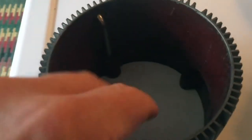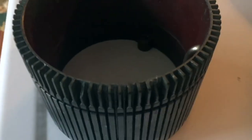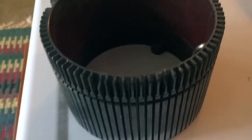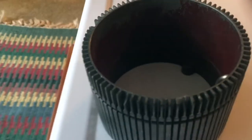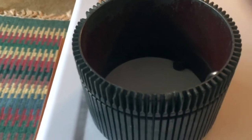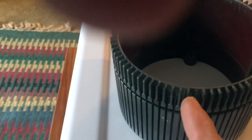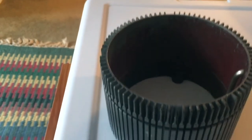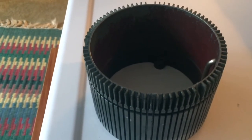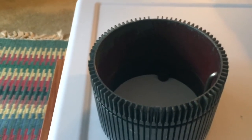There are actually four of them. When you look around the hole there's another one, and there are the other two. While I can actually use this cylinder as is with the needles in there, what happens is that since the needles stick up and the working part of the latch hook needles are towards the top, in the places where there's larger chips, as the wool or yarn gets pulled across, it actually pulls the needle closer to the other one. The resulting fabric has columns of stitches that are closer together than the rest of them.